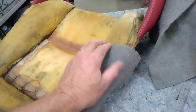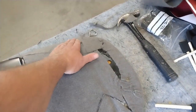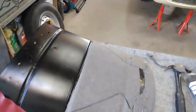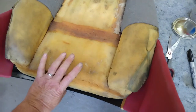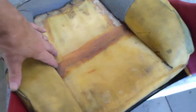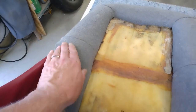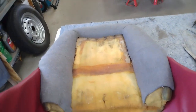I'll put a piece in here so there's no actual join visible. I have some of the felt glued on the back, just to even things out as much as possible. Basically below this line there's actually a section of carpet sewn into the seat cover, so I'm not too worried about down here. I've got the felt coming all the way around and I'm going to glue a piece on each of the bolsters so this line doesn't telegraph through the cover. I've got all the felt around the outside of the bolster and I'm quite happy with that. So next up is to fit the cover itself.